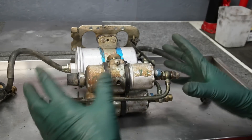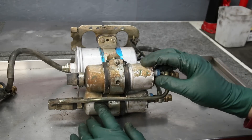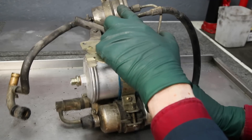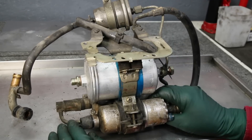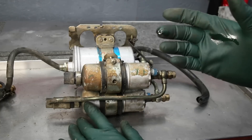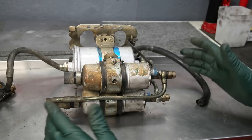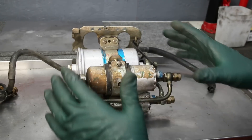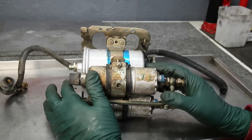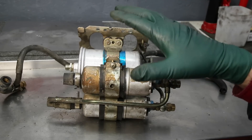Today I'm working on putting this all together as a kit, making sure I've got all the hoses and clamps. You'll get two brand new Bosch pumps — I do not believe in using aftermarket fuel pumps, I've seen too many problems with those. I don't have a problem with aftermarket accumulators because that's not a sophisticated electronic part — it's basically just a chamber with a diaphragm. My kit will include aftermarket accumulators, but all my kits from the 1970 D-Jetronic kit on up will come with authentic Bosch electric fuel pumps. I've got my work cut out for me, but once I finish this — FID number four — that'll hopefully be the last. Keep an eye on YouTube; probably within a week this kit will be ready to ship.